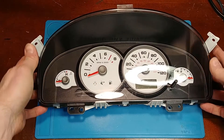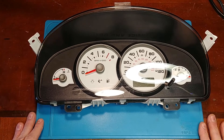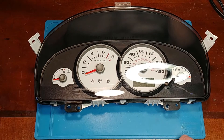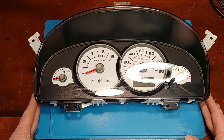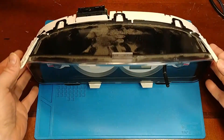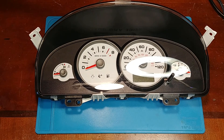Now that I've had a chance to go through it, disassemble and reassemble, I've got to say this is one of the more difficult clusters I've had to get into just because of the way that LCD display is sandwiched in the plastic — you've got to use hot air to remove it. On reassembly the plastic just wasn't quite letting that sit tight enough, I ended up having to hand solder it back together. So just because of that, I have to say this is one of the more difficult ones. Hope to never see another one again, but that's it for this video, thanks for watching.